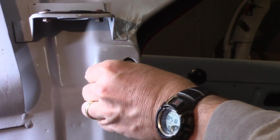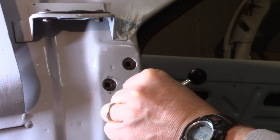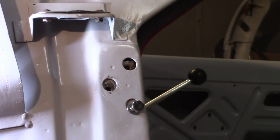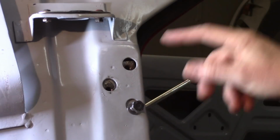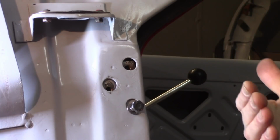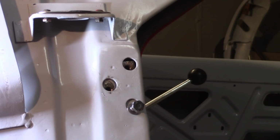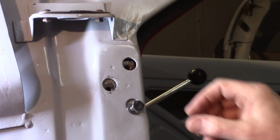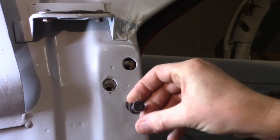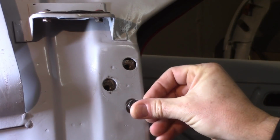So all I try to do is thread a bolt inside to the nut plate, bolt or two, and make sure I have full freedom of motion inside that area bounded by those circles to try to give me as much adjustment as I can get. On the back side, there's just little tabs that kind of hold that nut plate in place so that it doesn't fall out, obviously. So if I can go all the way down with it, the bolt itself touches the circle, and I can kind of make my way all around.